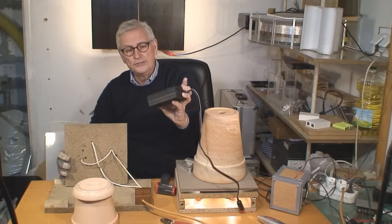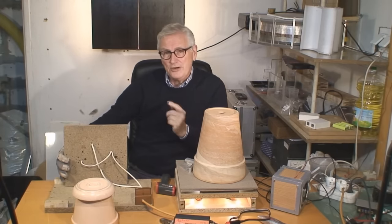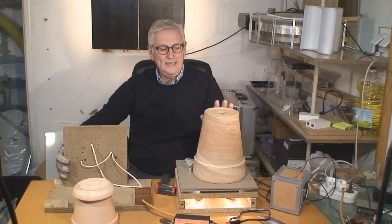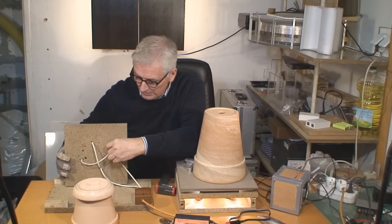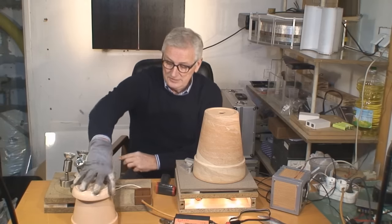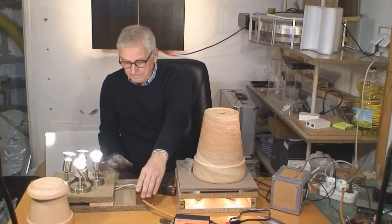I can use my little 300-watt plug-in for my van, which means I'm only pulling 80 watts. My tube heater currently running in the van is a 120-watt heater, and it doesn't get anywhere near the heat I'm getting off this. There are two leads: one running to bulb number one, which then feeds to bulb number two, and the second lead to bulb number three and then bulb number four. A bit of space at the bottom, a couple of spacers for the leads, and a double switch to switch on and off. That's the build — that's it.